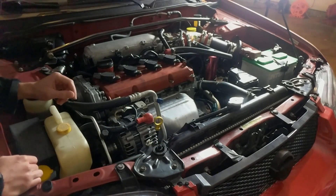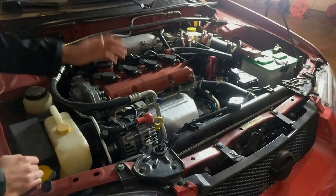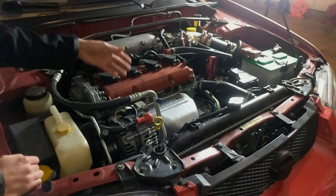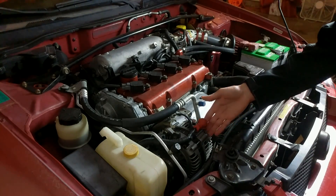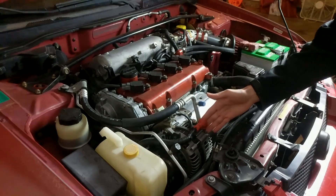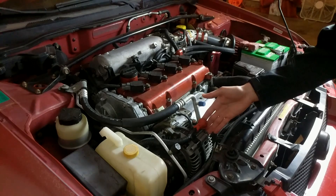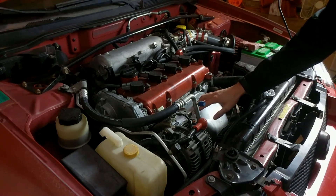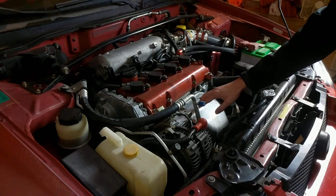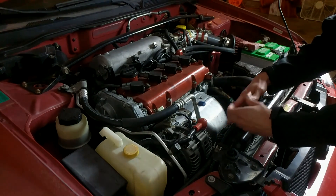The downside, however, is that you have more heat in your engine bay, and the odd thing about that is that it would help contribute to another one of the most famous problems with this engine. That problem is found right here in the form of the car's alternator. Because while this alternator seems like it's easy to get to, one of the downsides of Nissan placing it here is that it's directly next to the exhaust manifold. So most of the time when people get aftermarket exhaust manifolds, the extra heat from that goes right to the alternator and makes them fail prematurely.